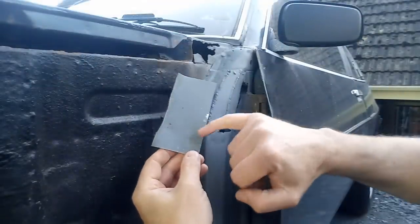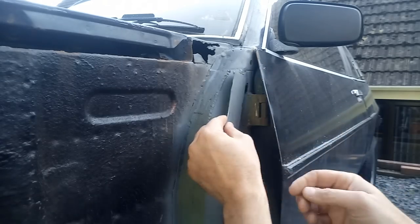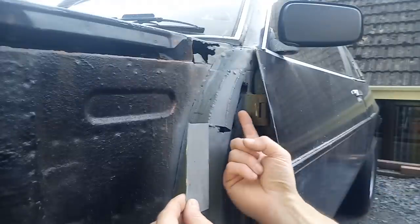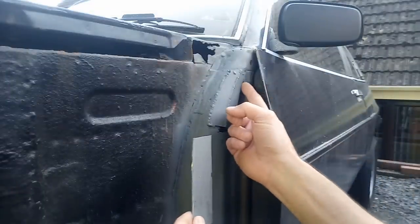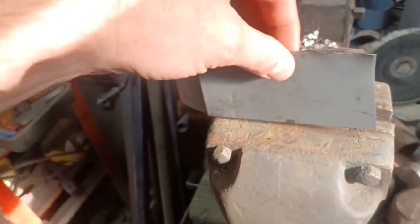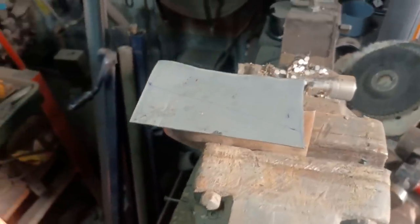So what we're looking at — I've got a journal line up there. I'll take this to the vice now and see if I can bring this up to give it a bit of a kick there, so I've got a bit of a kick that I want to bring up around there. I don't want to do this welded in several pieces because it's going to be difficult to get the weld in there. So if I can bring this up to join on that end, I can certainly get a weld onto that face there. There's a slight curve on this so I can't just clamp it in the vice. I'm going to use this which has got a greater curve than I need but it'll help me just to bend it over.